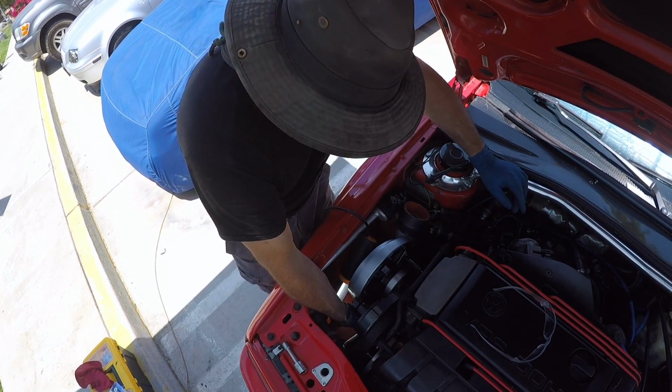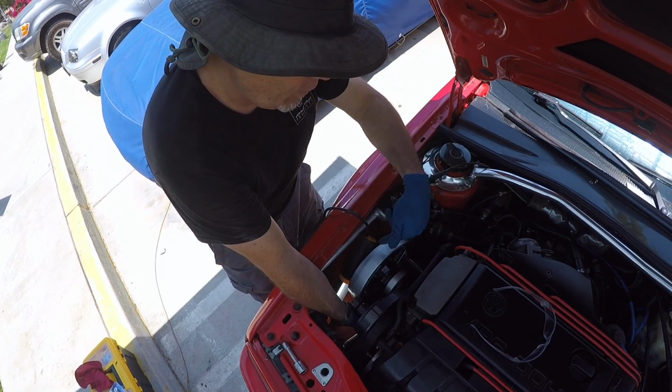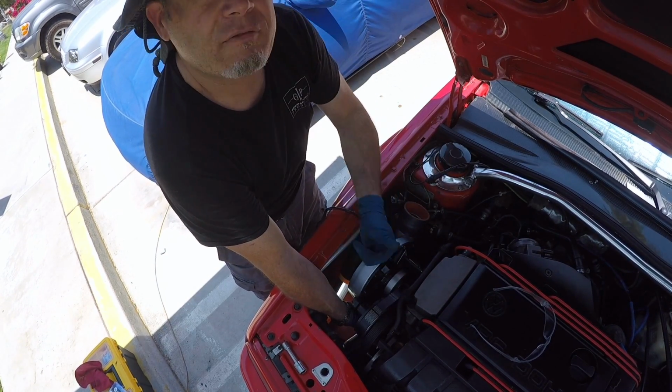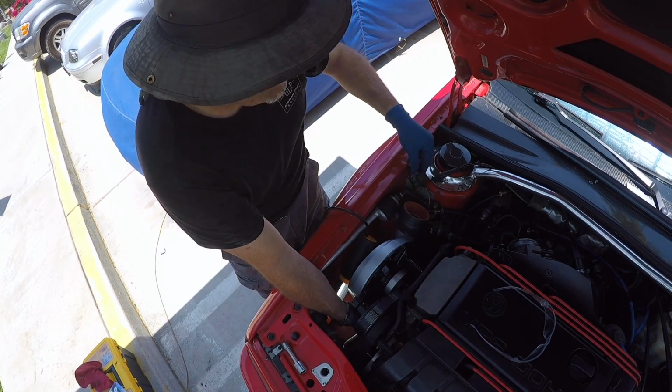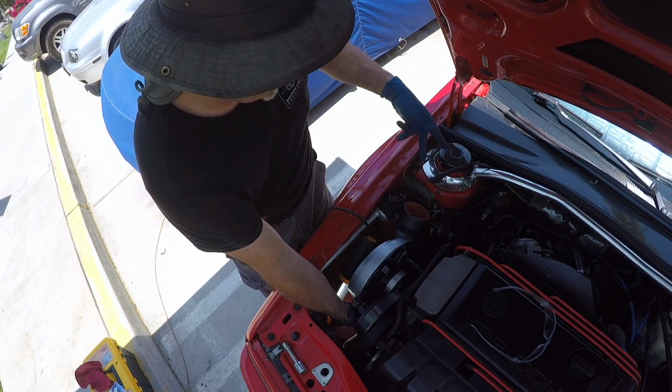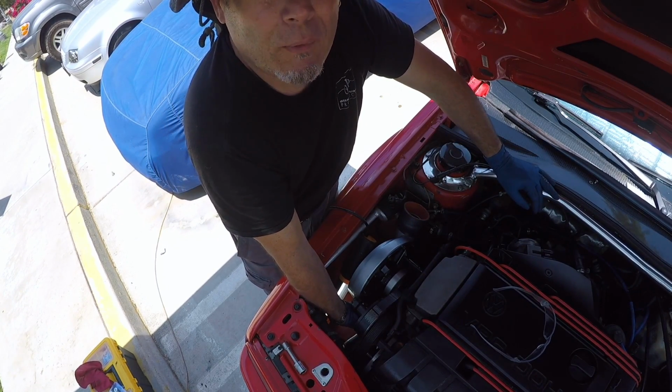I did discover that I'm gonna have to make kind of an elbow bend for the intake pipe between the supercharger and the mass airflow sensor, which is going to mount underneath. And of course, I do need to extend the mass airflow sensor harness because my used kit did not come with the extension. So we're just going to add wiring to it.